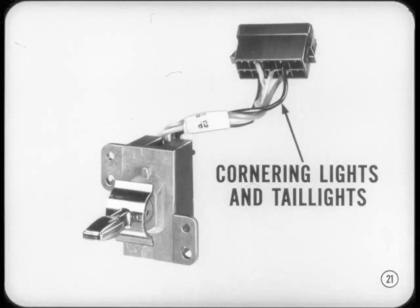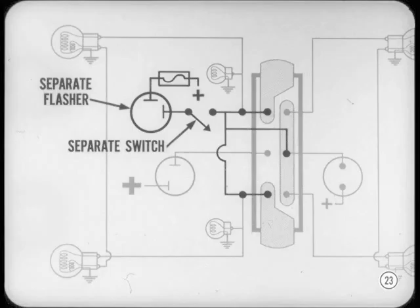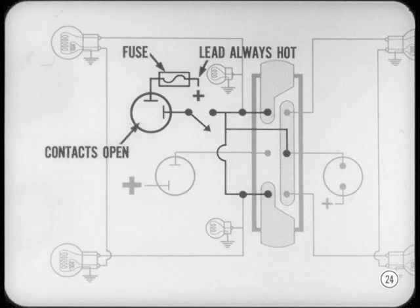That makes sense, but what's giving me trouble right now is operation of the hazard warning lights on this car. The turn signals work all right but the hazard warning lights quit. I know they use the same bulbs as the turn signals, so the trouble must be in the warning light switch, right? Well, it could be in the switch, Dan, but then again it might not be. The flashing portion of the hazard warning light circuit is entirely separate from the turn signal circuit — this includes a separate flasher unit and a separate switch.